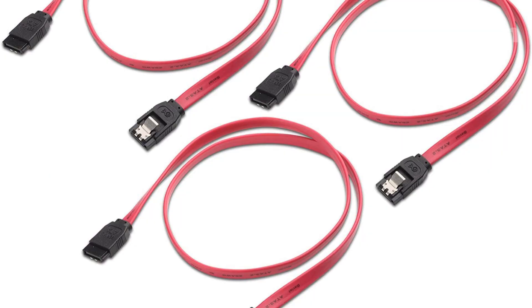There could be one small advantage with some SATA cables: a little clip that lets you secure it in the hard drive. This can be useful if you have a physical HDD that rotates and has slight vibration, and it's installed at an angle where the SATA cable could shake loose. But otherwise it doesn't matter. They may be rated for 6 Gbps or 3 Gbps, but speed tests show they perform at the same level. So just get whatever SATA cable fits and isn't broken.